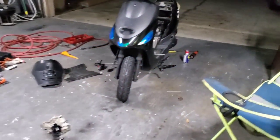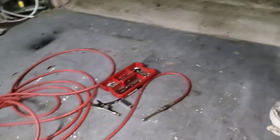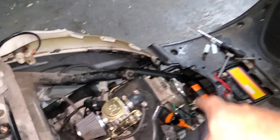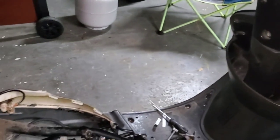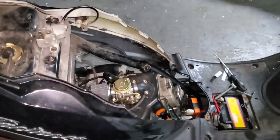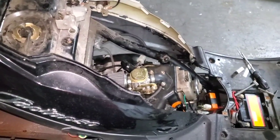Side case is back on, everything was clean, side covers are back on. Valves have been adjusted, all this is back together now, so we should be able to start it up and see how it sounds. This thing has a lot of miles on it - seven thousand miles - so it's never going to be perfect. It's definitely got some wear and tear on the engine, but it shouldn't be tapping nearly as much now.